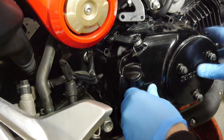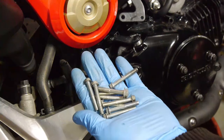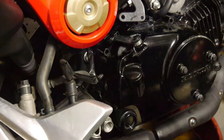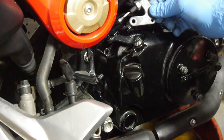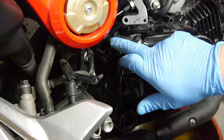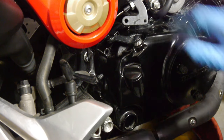Just give it a little wiggle and that's that. Next we're going to take our ten bolts and pop them back in. On this particular bike they're all the same size so it doesn't matter where they go. Just remember to locate. We usually put this one in last because we're going to be pulling on the clutch lever to make it easier, and then we'll locate the bracket on the casing.